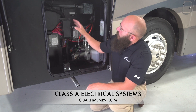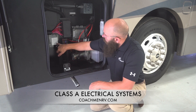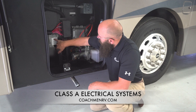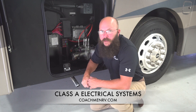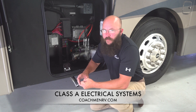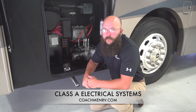The same applies on a Ford. This panel covers your more basic interior functions — your interior lights, steps tied into the ignition, hood lights, and power awnings. We make sure that awnings are disabled with the ignition when it's turned on. Anything we're really integrating into the drivability and safety of the motorhome will oftentimes reside right here.